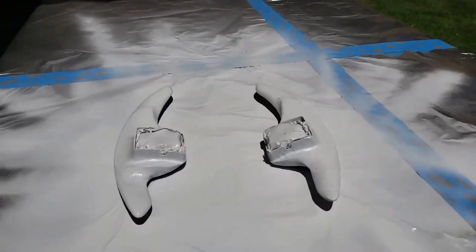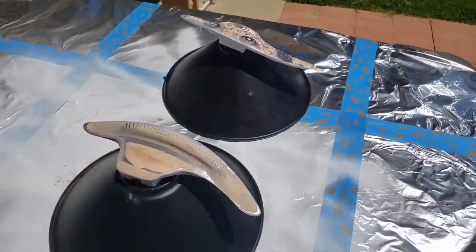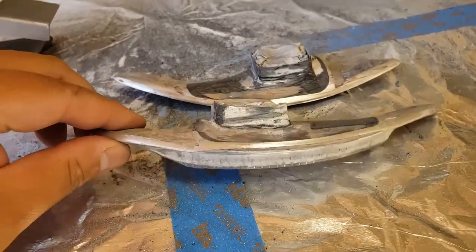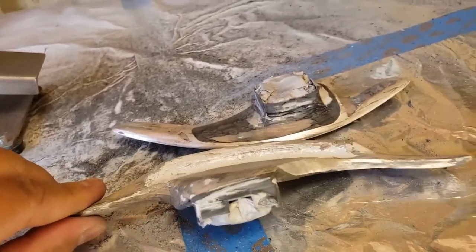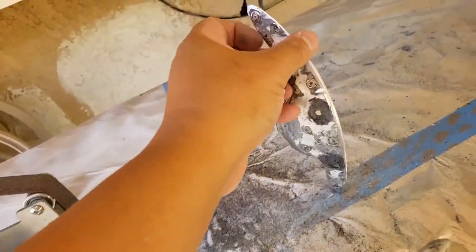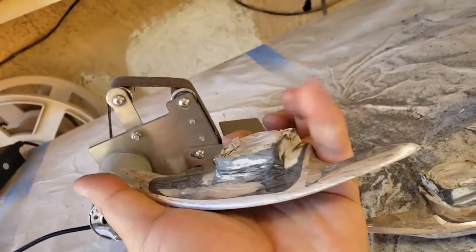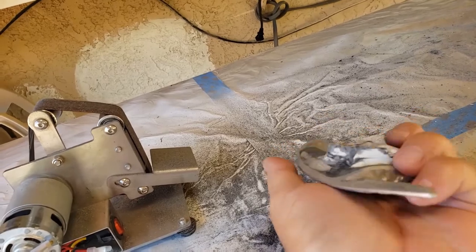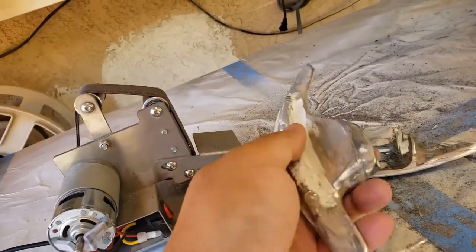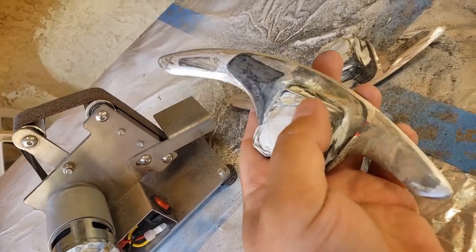First primer. Primer is on — first layer. I'm going to spray a primer on top. After primer yesterday, I could see the actual shape of the previous sanding. So this morning I came in and took down another 30% of the blade. Now it looks like a piece of knife blade. All the kinks are out — things from before disappeared. Sharp. Smooth. One piece of metal all the way down. It's great to have a belt sander because I can control the flatness throughout the thing. Now I'm going to take it from 60 grit to 150, and to 300. Ready for paint.